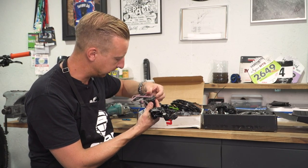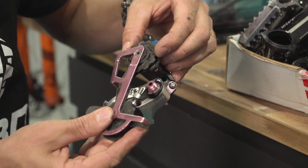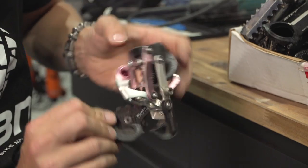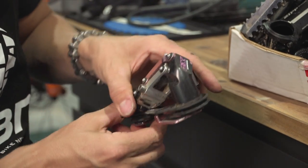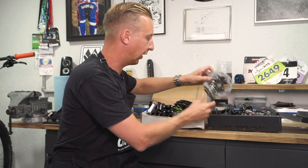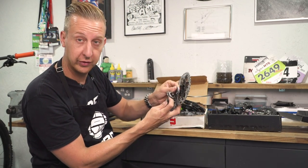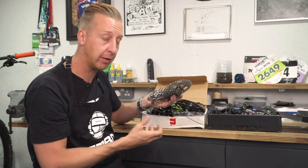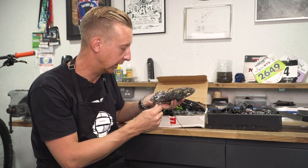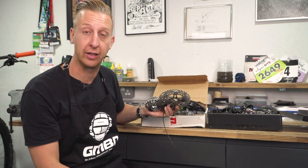Although these ones are dirty, they've still got a bit of life in them. This is a pretty ancient SRAM XO — one of their limited edition pink derailleurs from mid-2000s — but worth keeping for spares nonetheless. It's always worth keeping cassettes as well. On cassettes, you've got various different spacers, washers, and lock rings. Sometimes they can go missing, or you can get an odd combination on a bike where you can't quite get the spacing right — it's always worth keeping those little spacers. They will definitely come in handy at some point.